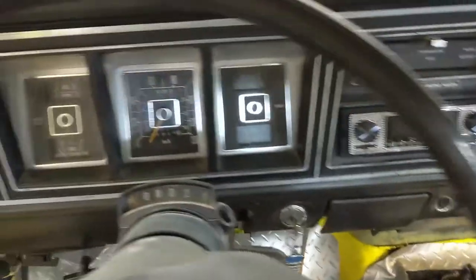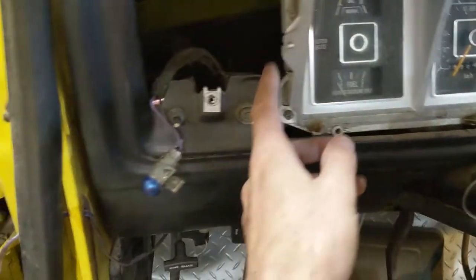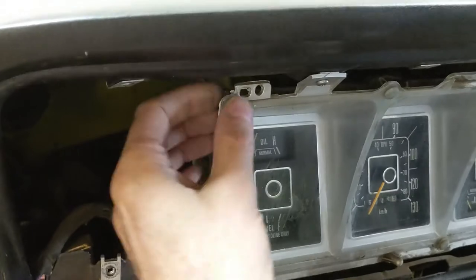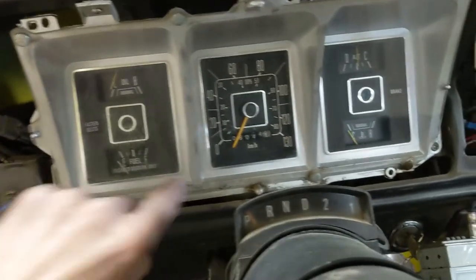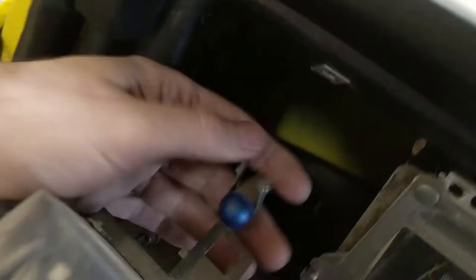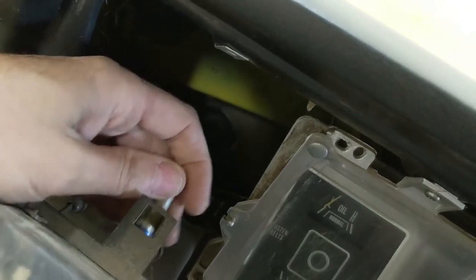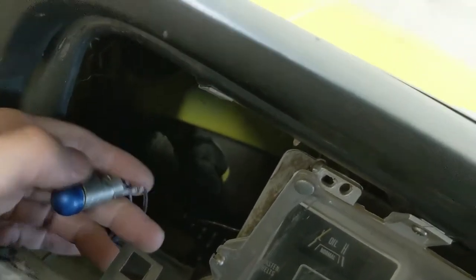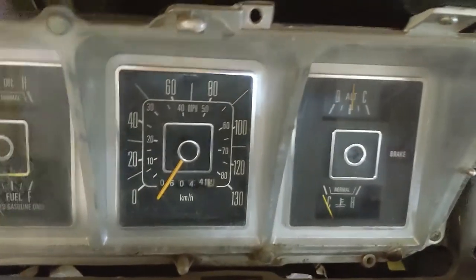I got the dash cover off and the faceplate — the light bulb is set aside for now because I didn't want to take the stereo out. I think I only have to take that cover off and readjust the needle to zero. The bulb for the washer and wiper area just clips into this slot — pinch the two tabs and it pops out. I'm going to leave the radio in because I'm only focusing on the odometer. Now that I have that wire unhooked, I can flip it out of the way and get back to work.